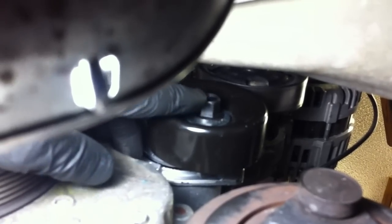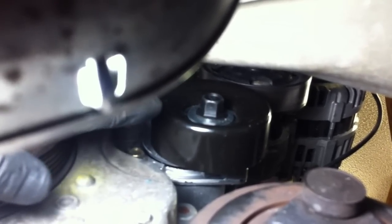If you don't have that belt tool, you can get a wrench on your pulley bolt right here. You want to rotate it like you're tightening the bolt to relieve the tension on the belt. There's enough room to get a wrench down here.